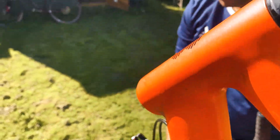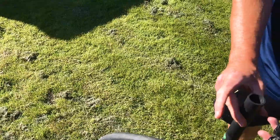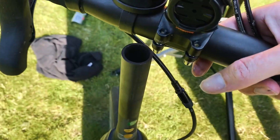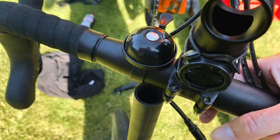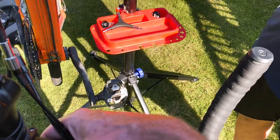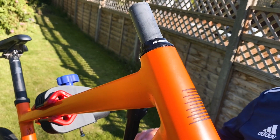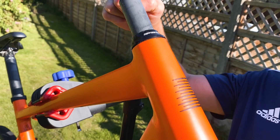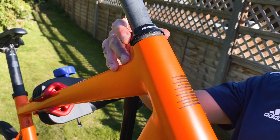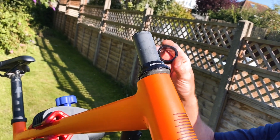I'm wondering if you have to cut five mil off this or add another spacer on top. I don't like cutting things because you can't uncut them. At the moment I think you've got enough compression, but I don't think there's enough space. Can't just remove a spacer — I reckon your top cap is clashing with that, so you're not getting any more compression. The top cap's just hitting that, and when you put your stack of spacers up on your handlebar it makes no difference.